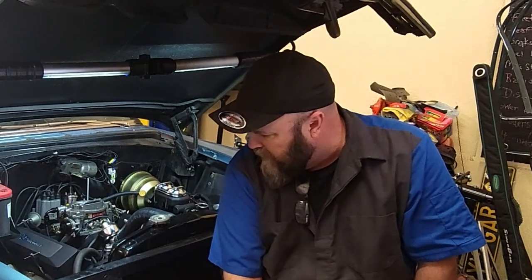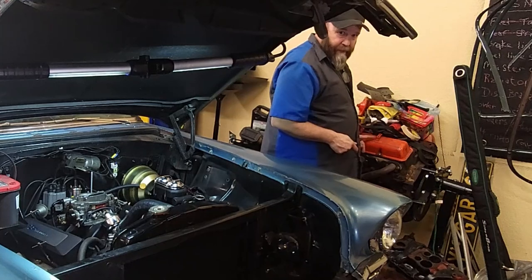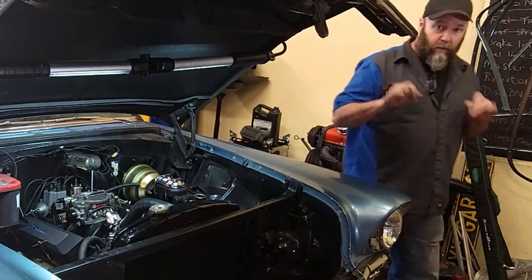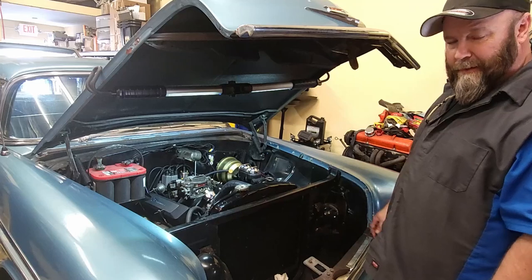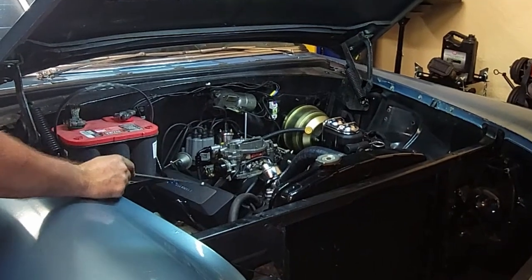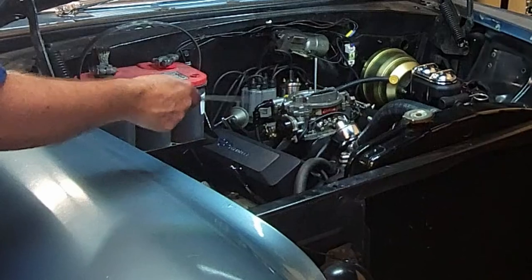Not fitting. Small block Chevy valve covers, not fitting. Billet aluminum one's not fitting. I'm baffled. Those were on this motor when I bought my 64. This is a 305 out of my 64. Those valve covers are on here. No issue. Zero issues. It's a 75 Malibu wagon is what that was out of. A 71 El Camino. You telling me the rockers are different? I guess if I put the chrome valve covers back on, oil fills right there. I don't have to worry about finding a breather for the back. I don't have to worry about changing gaskets because he's never leaked with those chrome ones.